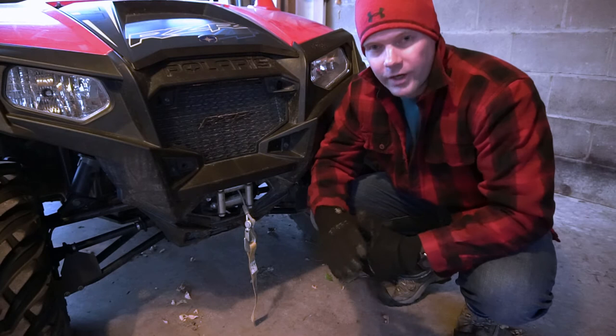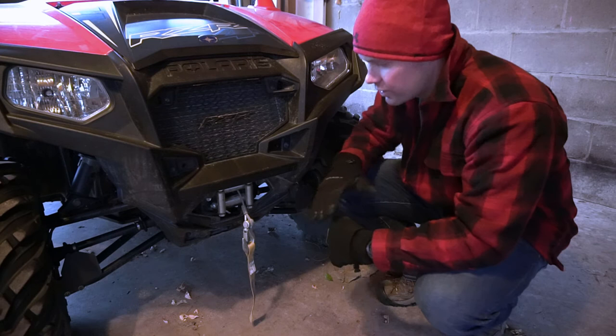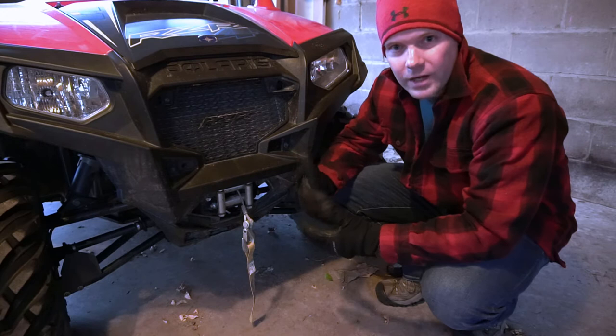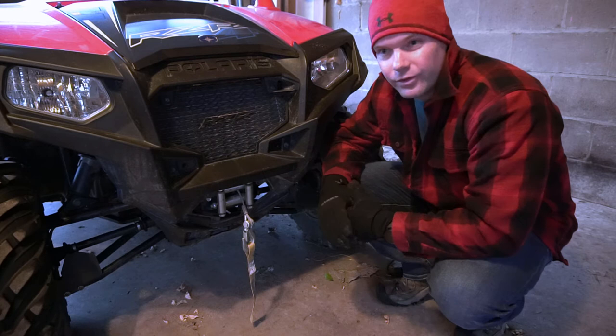First things first is a visual inspection of your winch. I'm going to get behind here, get my head up under the wheels, and do a full visual inspection — look for any damage to the winch, clumps of dirt, anything like that. Obviously if you're cleaning your machine often that shouldn't be an issue, but either way you just want to get back there and make sure nothing like a rock or a tree really banged into your winch. Make sure that your free spool knob is working properly. Check your wires, make sure there's no gashes in them and they're still tight to the winch — no nuts getting loose or anything like that. Check for cracks, dents, anything that might somehow have an impact on the winch.